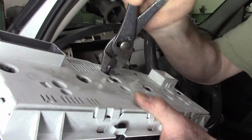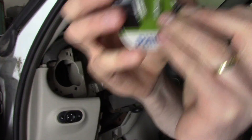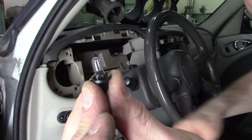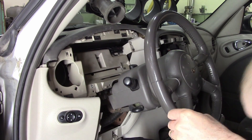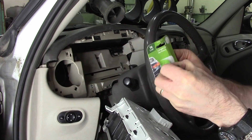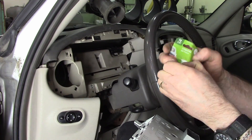The bulbs are LLB2s, or I think number 74s depending on what kind of numbers you want, and they just press into these little clips. When you take the bulb out and it looks kind of like it's been a little frizzled on the inside, or even if the whole thing looks like chrome, that means it's gone. Pull them out, push the new ones in. There were four bulbs that were shot on this cluster. They're just quarter turn and don't take a whole lot of effort. While you're tempted to reef on them really hard with a pair of pliers, resist that temptation and just gently send them home so you don't shear them off and then have to get the broken piece out of there — that would suck.